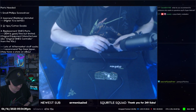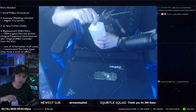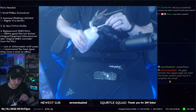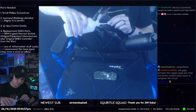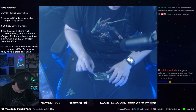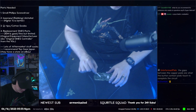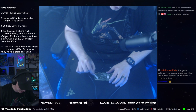Just be gentle. Okay. So we have our rubbing alcohol, isopropyl alcohol, however you say that. We have our Q-tip. So we just put the Q-tip, get it wet. Okay. And then what you do is you just gently wipe on the board, on the white part. Now we're doing down. Now we're doing right. Now we're doing up. You can do it twice if you want. Down looks a little dirty still.